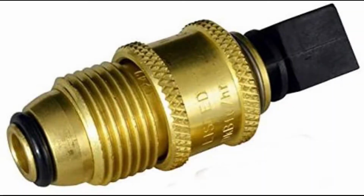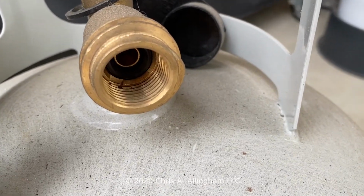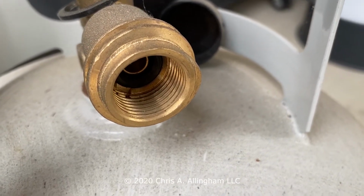and the other end it has a threaded connection that goes into the internal threads on the inside of a modern day propane tank valve. The downside to that is that every time you go to exchange that tank or refill that tank, you have to take out the adapter, make sure you don't lose it, or don't trade it away with the tank, get the tank refilled or exchanged, and then put the adapter back in and plug this back into it.